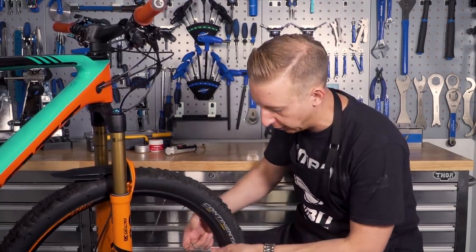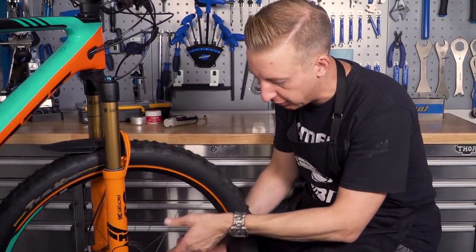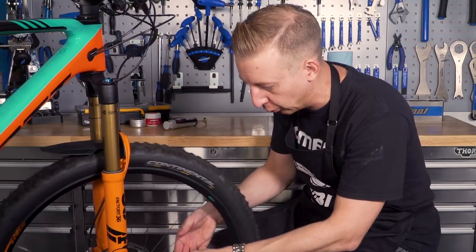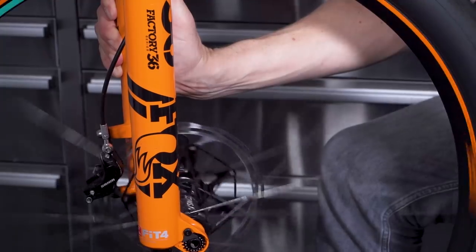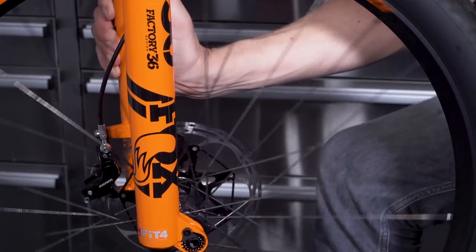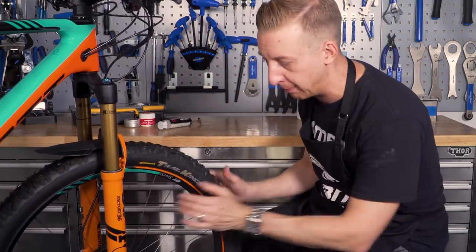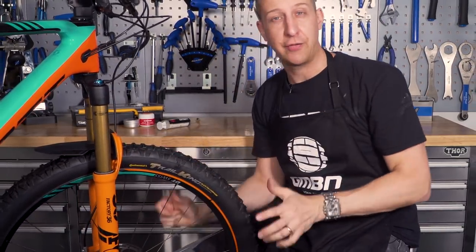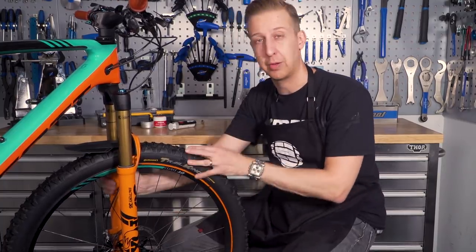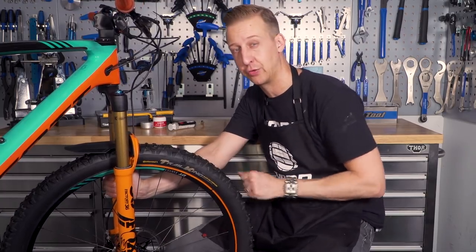As I'm working my way around the wheel, I'm looking for any visible damage to the rim. I want to make sure the spokes are all fairly evenly tensioned, nothing is out of place or loose. I'm also having a look at the disc rotor, making sure it's not warped, making sure everything runs nice and freely and in true. There shouldn't be any visible damage. You want to make sure there's no play in your bearings. This is just a spring clean — not a full service — you just want to make sure your bike is in good condition so you can hit those trails.